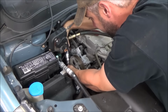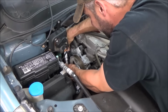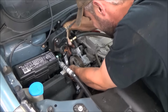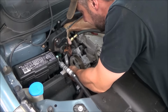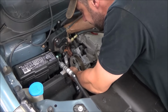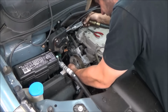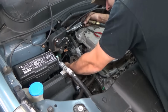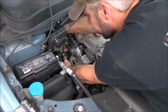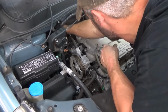If the power steering pump's in your way, you can just peel that off too. Makes the job a little easier sometimes. I'm trying to do it by feel here. Wow. There, we took something out anyways. Last one. That should allow our cover to come loose. You gotta take your uppers off before you can take the lower off.